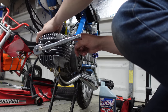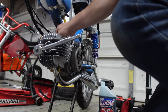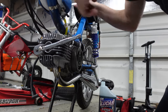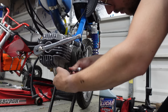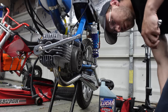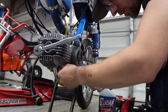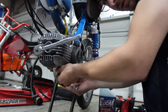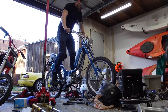What's funny is the amount of torque for the head nuts is the same as the completely cosmetic flywheel cover — I find that very amusing. At this point I need to tighten up the exhaust, then triple check myself on the torque for the head and fire it up. Well, put the spark plug in first. I'll probably clean the spark plug — looks like it was running a bit rich, which I attribute to the fact that when I tuned this it was about 40 degrees colder outside than it is now. Just going to rotate her a bit. She's got good compression.